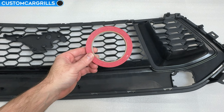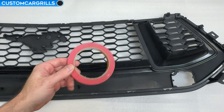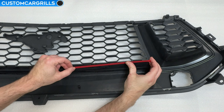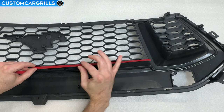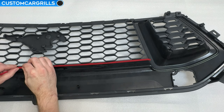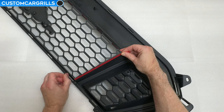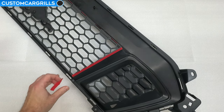For the main big cuts I want to cut the back at a fixed depth and there's no better way to do that than by using a tape line. On this grill I'm using a tape that's exactly a half inch wide. We want to have the edge of the tape on the back edge of the grill. When we're done we're going to be left with a clearly defined cut line that's at a fixed depth. It's important to use a half inch tape because the mesh set is designed with that in mind and cutting it at a different depth may require some adjustments to the mesh pieces.